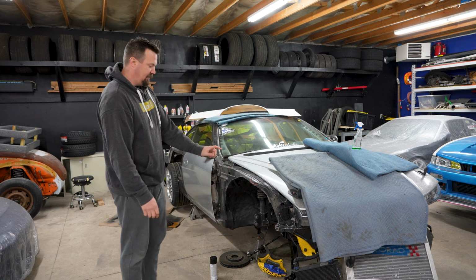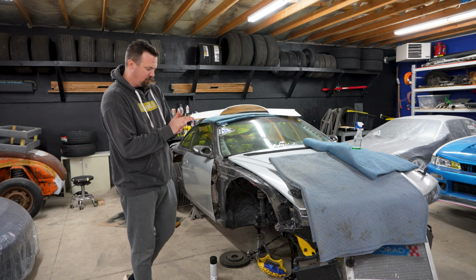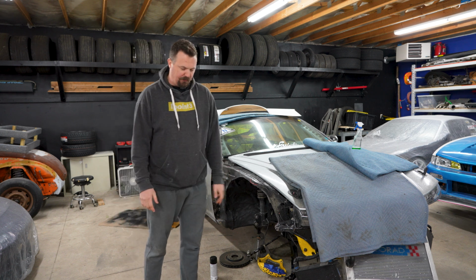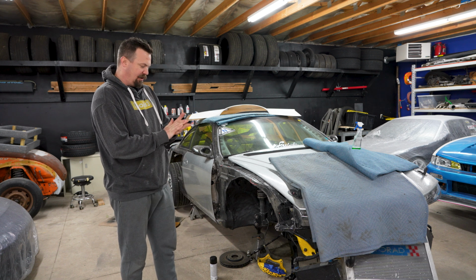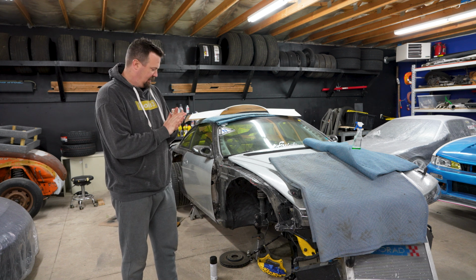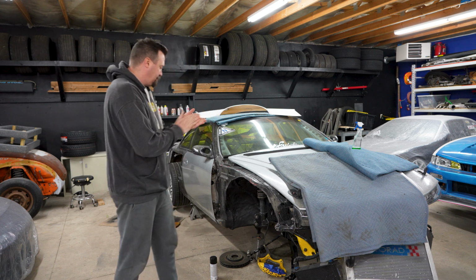So all that's good. I got the new subframe in there. I got the new lower control arms there. The tension rod bracket is yellow, chipped up, and nasty. I think I'm gonna pull that quick, and paint that, scuff that, and paint that. So I wanna get that black.